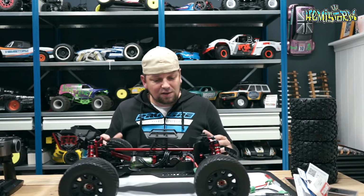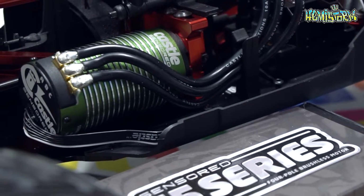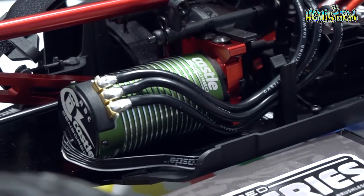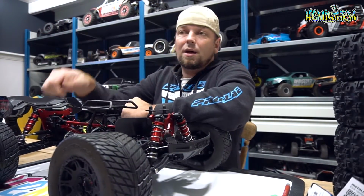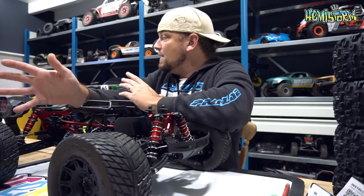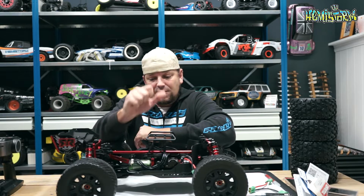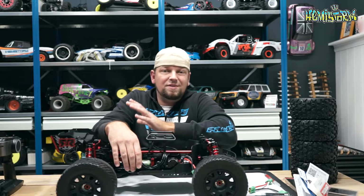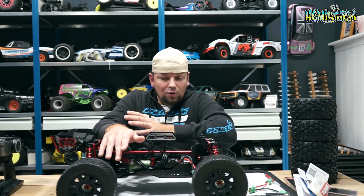One of the first things that I think we should mention is this green monster over here. This is something that you might be familiar with if you watch my channel for a couple of years already. This is a motor that I have used in multiple setups, but this is actually one of the first times that I'm going to use it in a sensored setup. This is a Castle 1515 motor, 2200 kV. These perform fantastically well in any type of 8-scale setup. So no different in this case.